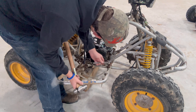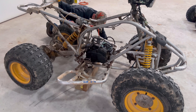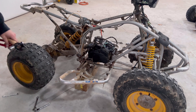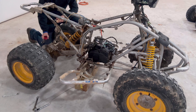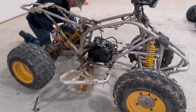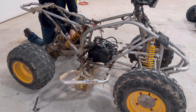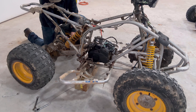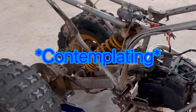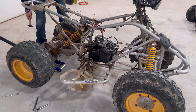I don't want to take it out all the way because I still got a little bolt down there that's gonna be fun to get to. What's ending up having to happen is I'm taking the lower bolt out of this rear shock, then I have to lift the swing arm up to be able to get to that bottom bolt holding the motor in. The swing arm is just in the way — would have been easier to take the top bolt out first.